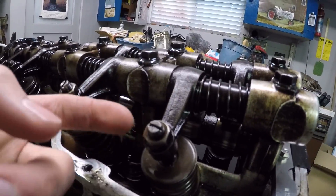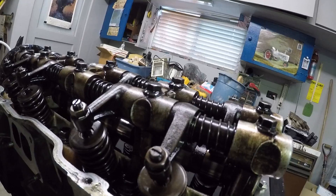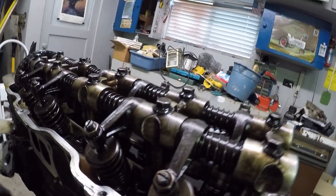When you're putting the motor to top dead center, everybody does it a different way. You can put a 27mm socket on the pulley on the front, but you won't be able to do that because the fan and cross member get in the way. You can bump the starter, or turn the fan belt using the alternator. If you don't have a clutched fan, you can just grab the fan and turn it. The torque spec on the nuts on top of the rocker arm is between 12 and 16 foot pounds, so a small torque wrench would be perfect.